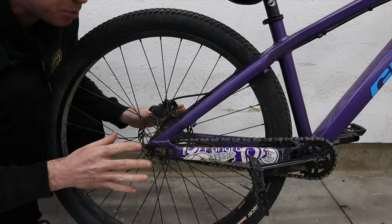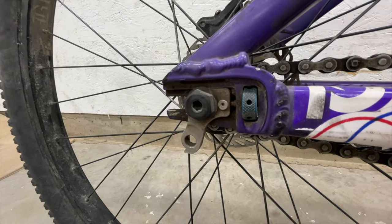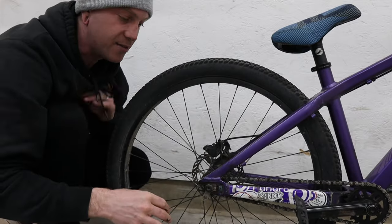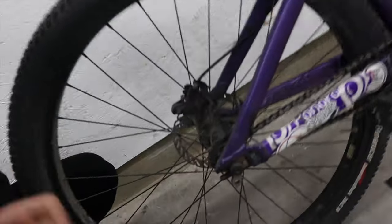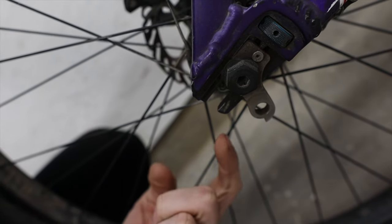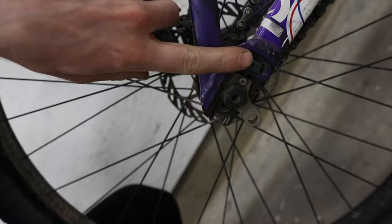The second thing that really solidifies its place as a great dirt jumper is the redesign of the dropouts. These are an adjustable horizontal dropout and they have a built-in derailleur hanger. The STPs originally come with drivetrains, but this makes it a lot easier to do a single speed conversion — you don't have to run a tensioner. You just spin these tensioner bolts that push the axle back in the movable dropout. It's something you actually see on the Canyon Stitched 360 today, and this integrated system appears on bikes 13 years later.